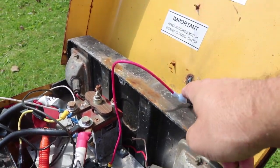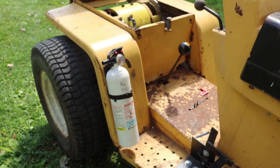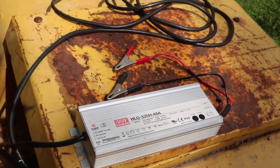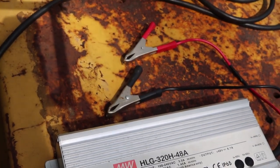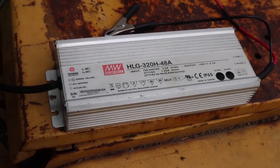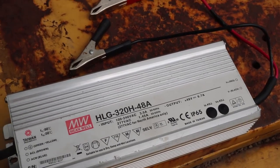Up here I have a strobe light from a forklift so that when I'm driving around, it actually flashes. The parade itself required a fire extinguisher on every float, so I put one on there. And how I was charging the Nissan Leaf batteries was with this Meanwell power supply — I had a couple of these hooked up on my electric motorcycle and used them as chargers on my Loop the Lake trip. It's a 48-volt weatherproof power supply with adjustable current and adjustable voltage, and I had it set to 49.2 volts.